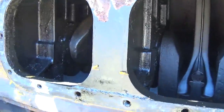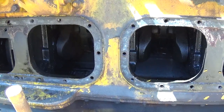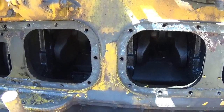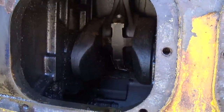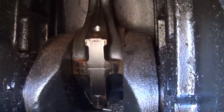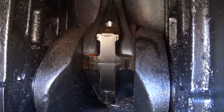Looks like number three and number four are the culprits here. Which makes sense when you think about it — those two cylinders are the closest to the exhaust outlet of the manifold. So if there was water coming down the manifold, that's where it would go first. They're both a little more than halfway up the bore. Doesn't look like much got down. The top of this rod throw has some dirt there, and the lower end of the rod looks like it's got a little bit of surface rust on it — doesn't look like anything too bad.